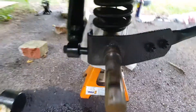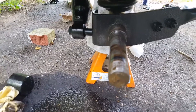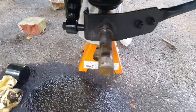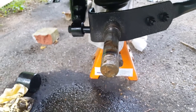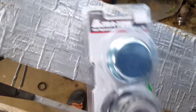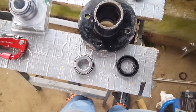Quick update: I finally got both sides off. All the bearings are out — the rear bearing on one side was stuck and took me more than a half hour just to get that one piece off. I was afraid it had gotten too hot and melted on, but I finally got it and the washer off. I picked up an Ultra-Tow hub replacement kit from Harbor Freight — supposed to be the right size at one-inch diameter. Got the hubs off, need to grease them, and we'll see what happens.